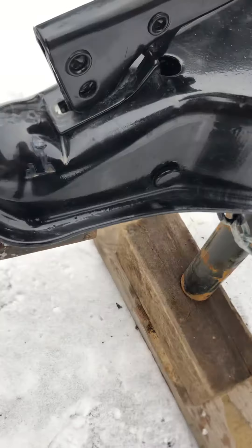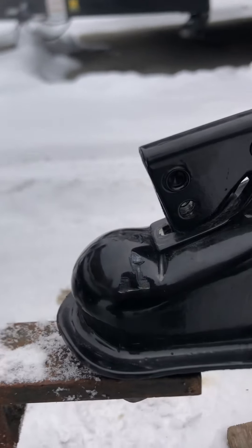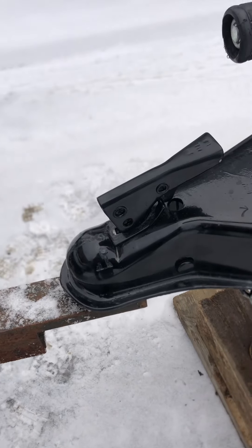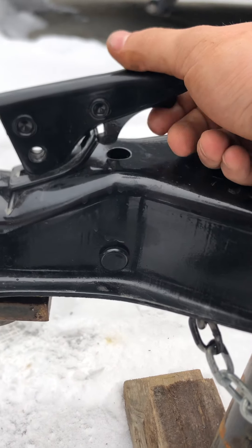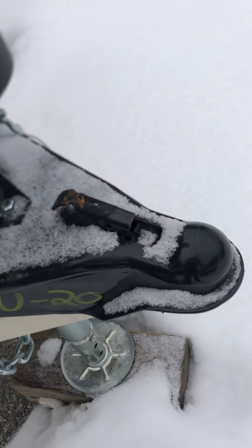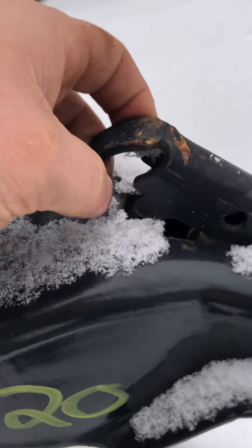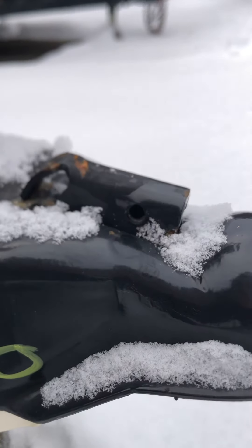On this kind, you just push this back and it'll lock, and then you put a pin or a bolt with a nut through there — that locks the coupler so it won't come off. There are mainly two or three kinds of couplers. This kind is more common on smaller trailers and has a little lock right here to flip up when you're unhooking. On this other trailer right here, you've got this slide — you pick it up, it slides forward, and there's a little groove that locks it so it can't slide back. Then you put your bolt or pin through that hole. It's all the same basic way to hook it up.